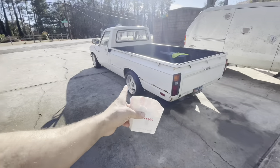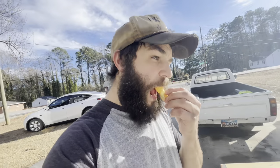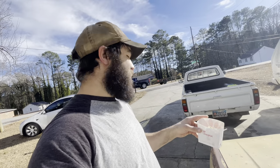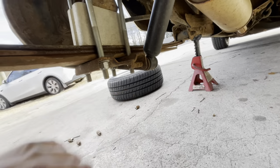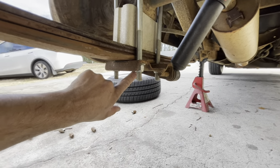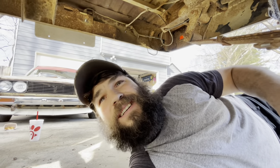Plan for today, first order of business, is going to be to bring that rear suspension down. I think we're going to go with just pulling the center leaf out of the pack. We'll just pull each center leaf out, throw it back together, see the height we get. They do like to use this thing to move engines around, so I might end up adding that leaf back to see if we can come up with an orientation that gets us both as low as we want to be and a little bit stiffer spring rate. We're going to blast our U-bolts loose, unclamp our center leaf front and rear, lift the axle up, pull our centering pin out of the leafs, pull this center leaf out, put the whole pack back together, put it back on the ground, see where we're at. That's the plan.